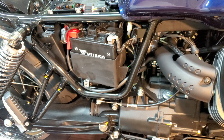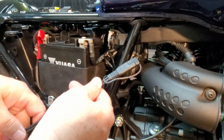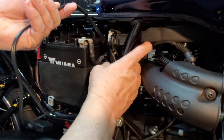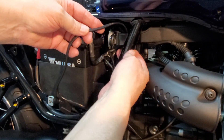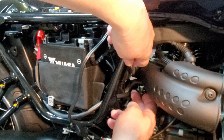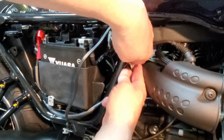We'll take a look at what we've got here for battery cables. What I've decided to do for routing the cable is take the end that'll connect to the charger/maintainer and run it behind the positive battery cable, back like this and then back in behind the cable. Then I'm going to tie wrap the top end right here. This will be back here and out of sight, but if I want to plug it in, I can just reach back here and pull it out. Otherwise, when I don't need it, I'll just tuck it back in behind there.